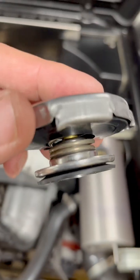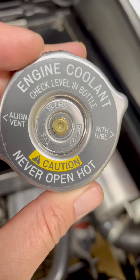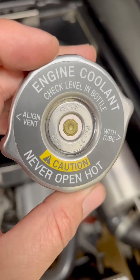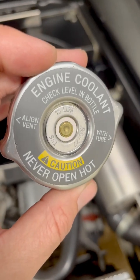This is what it's supposed to look like. You need to check that spring right there. You need to use a coolant cap that is rated for 15 pounds. The 15 pounds acts as a relief point — so if the operating pressure in the system exceeds 15 pounds, this actually opens up sort of like a relief valve.